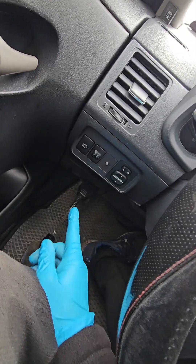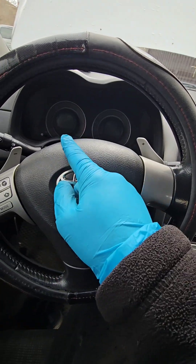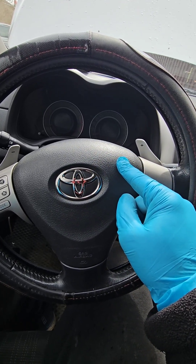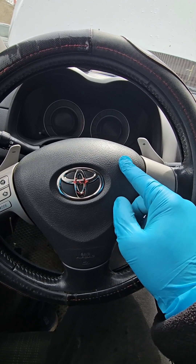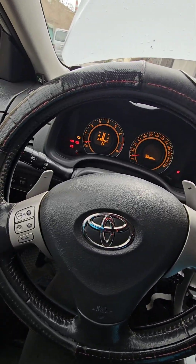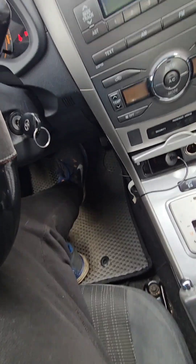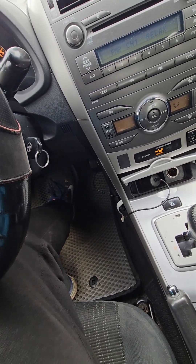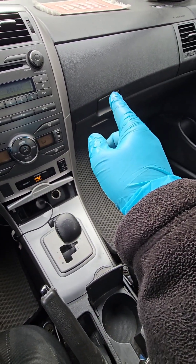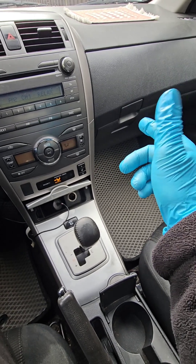Installing the bridge wire — this is the only bridge wire from pin four and pin thirteen. Turn on ignition. All lamps are flashing. Pump the brake pedal seven times fast. The computer makes beeps — beep beep — it's ready to receive the command for calibration or clamp position.